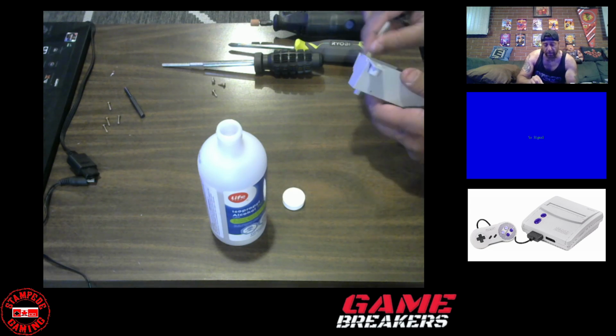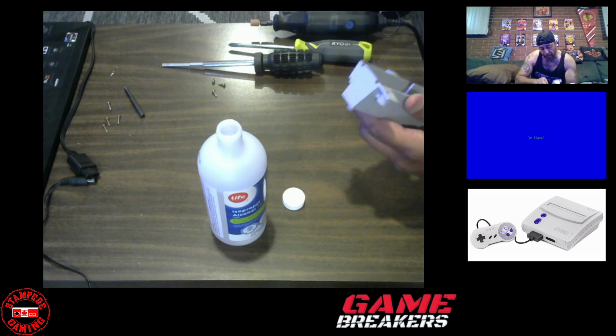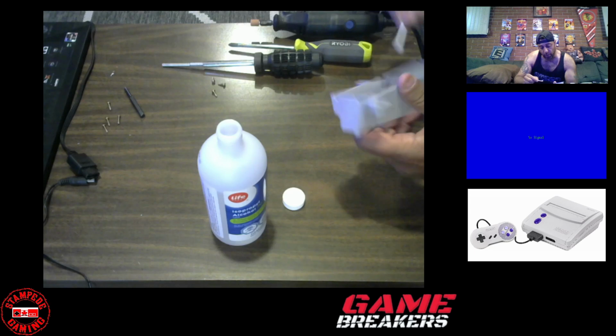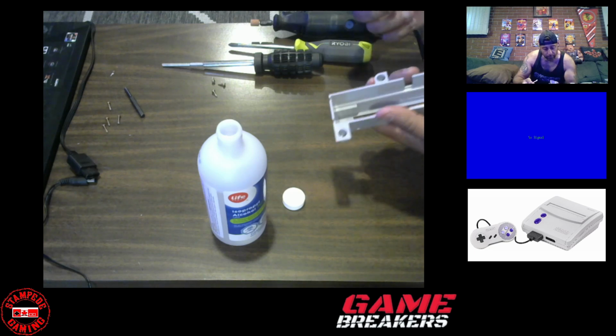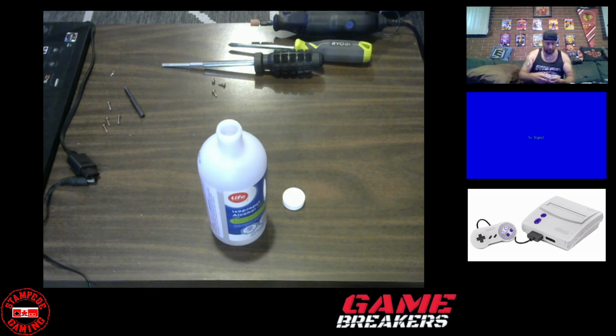I'm not really going to clean the Super Nintendo cartridge slot because it is working already. And it's nothing different than what I showed you before, right? It's the credit card method, right? Take the credit card, wedge it between a folded piece of sandpaper, and just go in and out and scrub it. And that's pretty much it, guys. So, this should work. And we're going to try it right now.